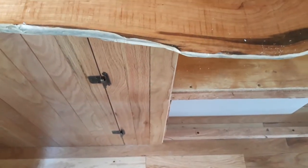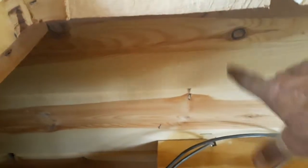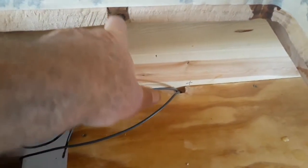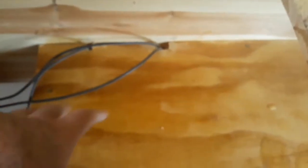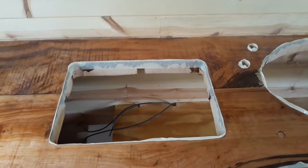Okay, second door's in place, and I guess you could say I've reached a stopping point, because in order to put the stove in, I'm going to have to drill a hole through the wall outside so that I can hook the propane tank up. And I need to get that taken care of because my batteries are going to sit right down in here, and I need to know how much space I have to have for that hose, because I'm going to put a T in it so that I can run it over to the water heater when we get it. But I got to put my batteries in here, and I got to have room for that hose to get in there before I set all my batteries in place. So I'm going to head over and pick up a drill bit so that I can drill all the way through to the outside wall, and I'll be back.